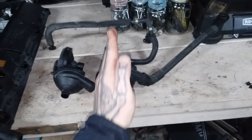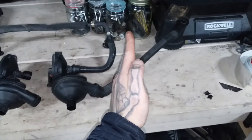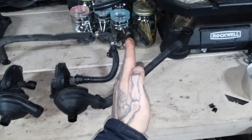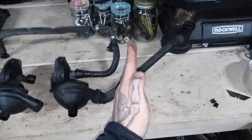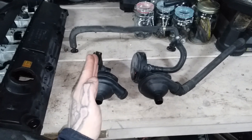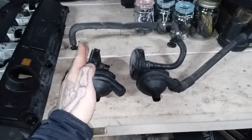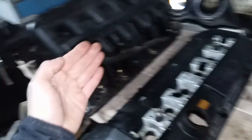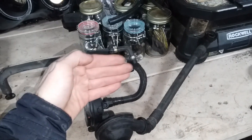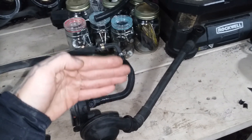So we're going to have a wall — two sides to this wall. The right side is going to be vacuum, which is negative pressure, which is what these engines are normally operated on. Then we come to the left side of the wall, which is positive pressure, which would be boost from a turbo or supercharger — forced induction. The CCV valve is designed to operate in one way and one way only. From the intake manifold, it is sucking — it is evacuating the crankcase of the vapors it creates. It's constantly sucking vapor this way.